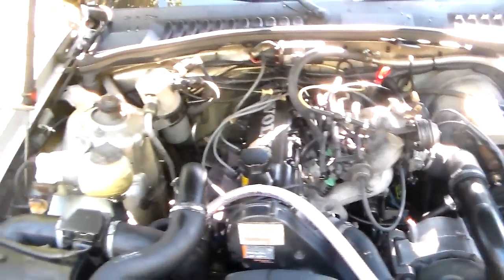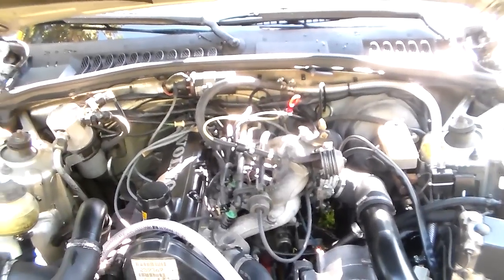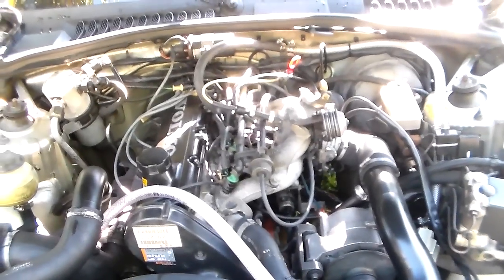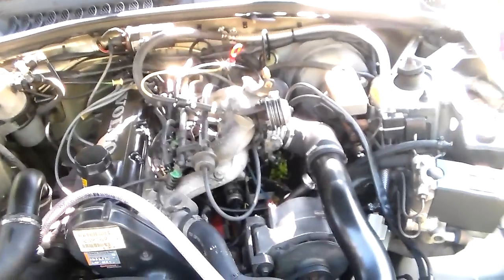So when something like that happens, guys, when you have a carburetor or something even like this, and your idle adjustment, something that controls airflow, makes no effect anymore, usually you can consider that it's not the problem, that's a symptom. You've got something else going on.